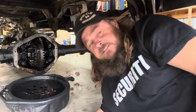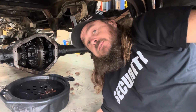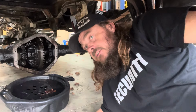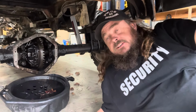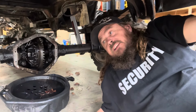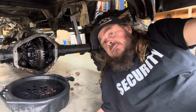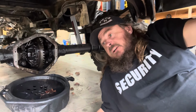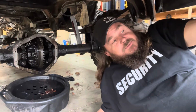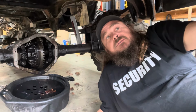41 divided by 11. Oh, wait, I'm wrong. Should have went to school. That's 3.73. That ain't bad though. 3.73s. Yeah, 4111. So 4110 would be 4.10. 4111 is 3.73. That's not bad though. 3.73 with a 4-speed, he'll be able to handle that. That'll go down the road good once you're going. Don't have a lot of trailer towing power, but it don't even have a hitch.